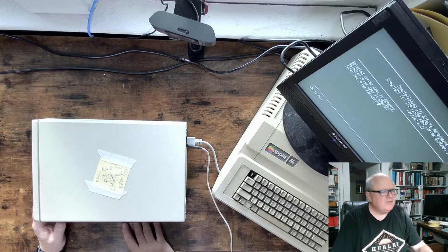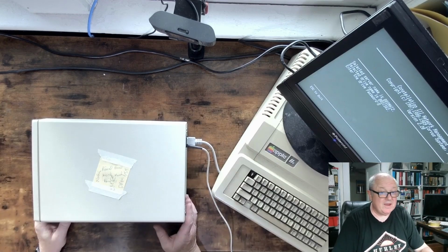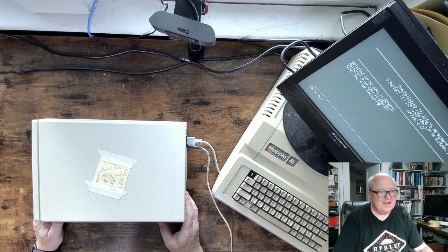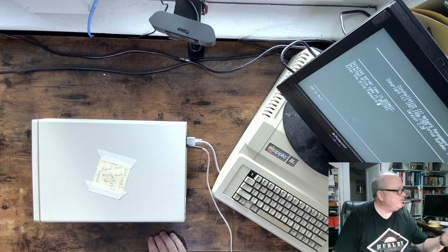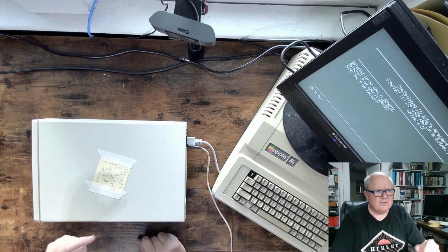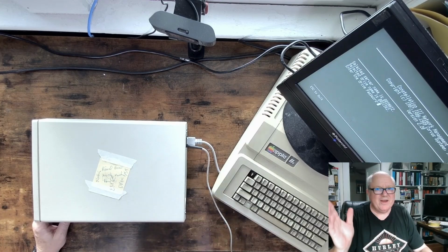So I went and got another SD card, formatted it, and downloaded the latest stuff from DREM, put it on the card, put it in there with the 45 meg images, and updated the firmware just to be sure. Everything worked fine. And everything was going well there. I said, okay, well, let me just reformat the SD card, because the one I had was one of those micros with an adapter, and I wanted to use the full size, and it came with the full size. And so I reformatted it, put it in there, started getting all the errors again.